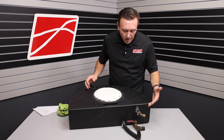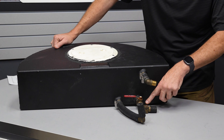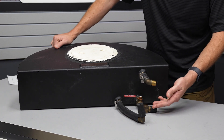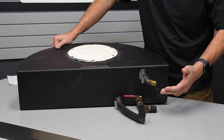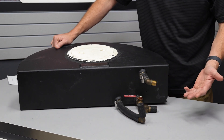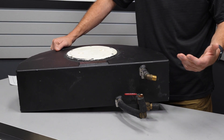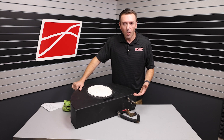You can see here that this tank has got some fittings on it. This looks like the drain line right here — common hardware store, Home Depot style fittings, some rubber heater hose. Rubber heater hose is perfectly fine to use on high-performance vehicles and works well in an engine bay environment, but it just doesn't seem to give you a whole lot of options.